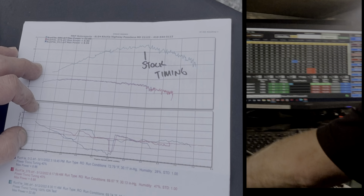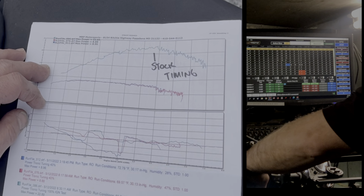And typically, on most programs, you'll have at 13% air fuel, if you're at 13.5, you can add or take away 5. It's usually 1% per point. On that one, it was a little bit different. Sometimes I would have to do 5 for like 3% or something like that. So there was a little bit of discrepancy there.